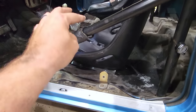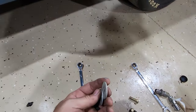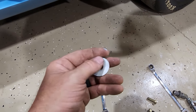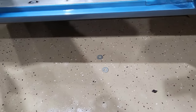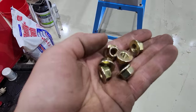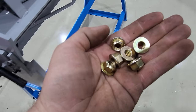All six bolts slid right down into place. I'm going to use these big heavy-duty washers, but I'm going to get some flat serrated nuts with a flange on them so they bite good. Crawl underneath, tighten them up, seat's down. These are grade 8 flange lock nuts, so they should grab those washers pretty good.